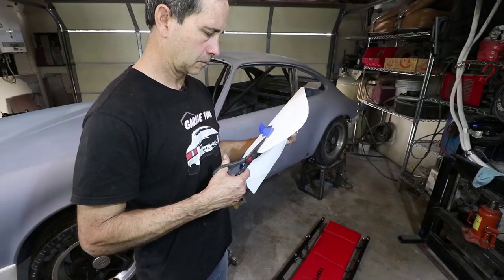I think I need to trim this, then straighten it and start tack welding down here. Where it fits good, I weld it — that's what I do. Fits good, weld it, until it's all done. Okay, time for a status update — this is about maybe 60% welded in. Along these edges it's pretty easy to weld because this is much thicker and sucks up a lot of the heat. There's more work to do here — it's kind of stitched in places.